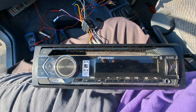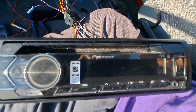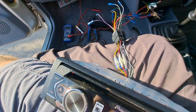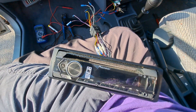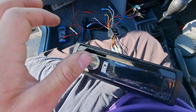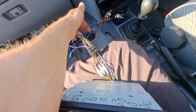Let's see — hear a click. You might be able to see the clock. So that is on auxiliary, and that's off. Now we've got it on auxiliary and it fires itself up and stays on the whole time. We've now made it so we've got a radio that comes on with the auxiliary circuit, working on the key, on a turn on and off circuit like it needs to be, with a direct feed which helps it hold its memory.